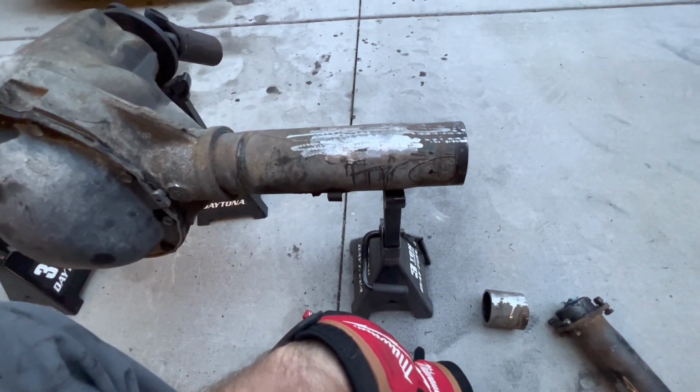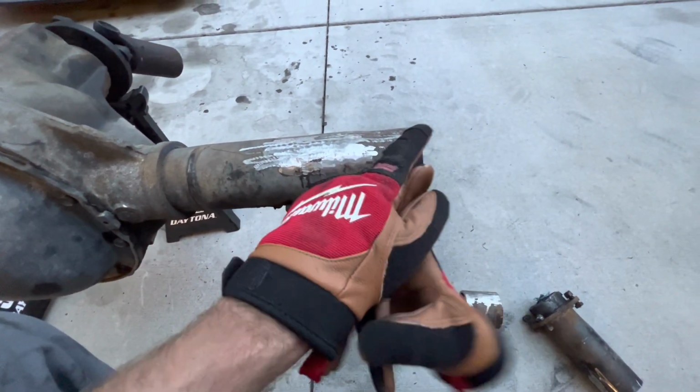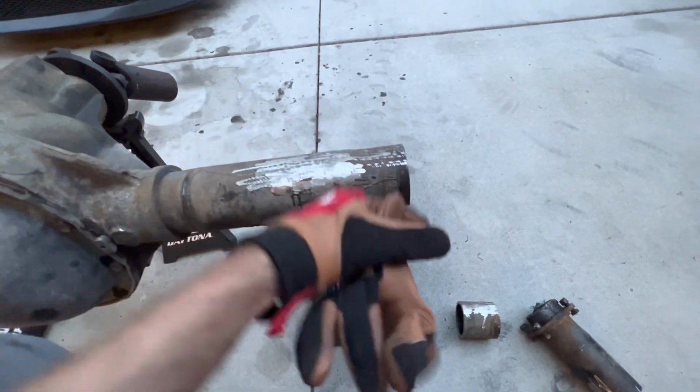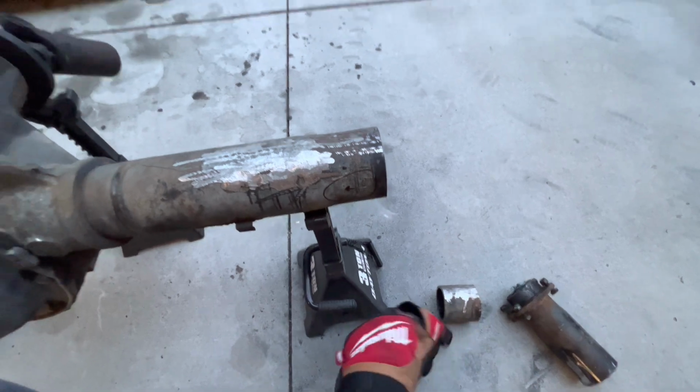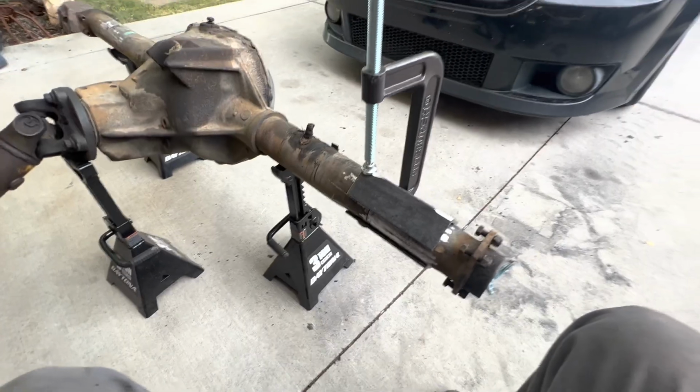And then what I'm going to do with the angle iron is I'll cut 2 pieces that are about, I don't know, 8 inches long, one for the top, one for the bottom, and I'll clamp them together, and then that'll keep me square while I tack it together.